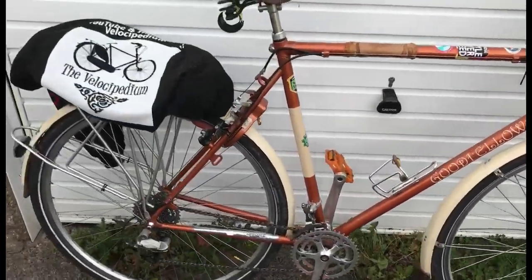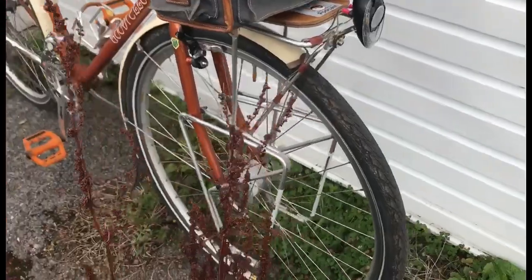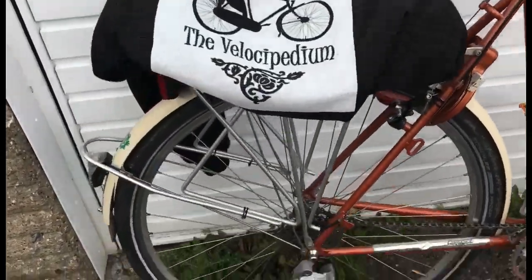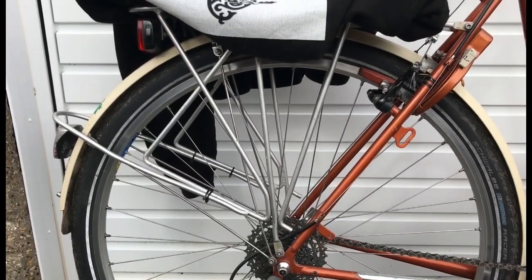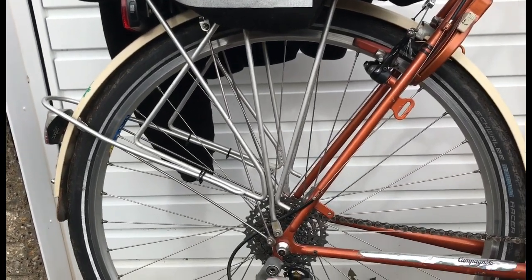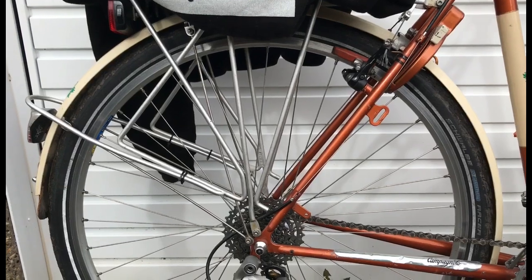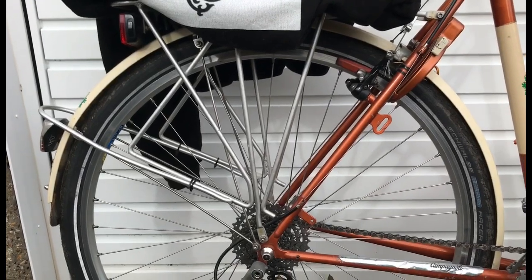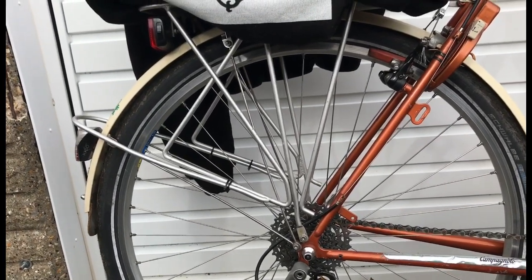After that first little ride, during which I also tried out the new gimbal, these tyres don't feel a great deal more supple than the smaller tyres that were on. However, two factors at play. The sidewalls on the Panaracer Pasela Tour Guard are very thin and very supple - not so much on the Marathon Racer, although they are a supple version of the Marathon. Also, I just pumped these up and put them on the bike and haven't really played about with the tyre pressures. I think I'm going to let some pressure out - they may be a little bit hard at the moment - and I'll report back on how it goes.